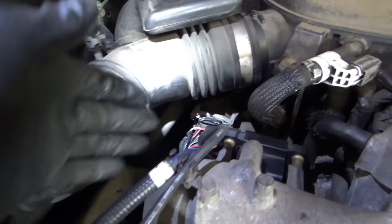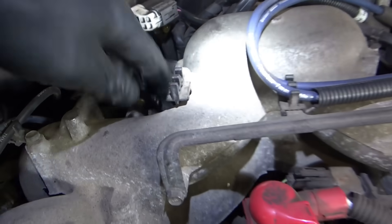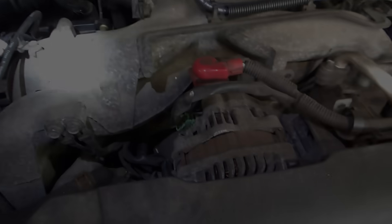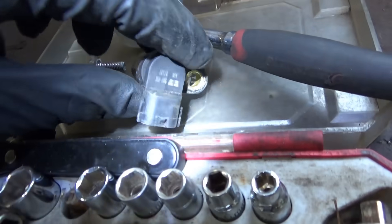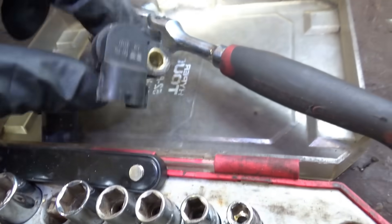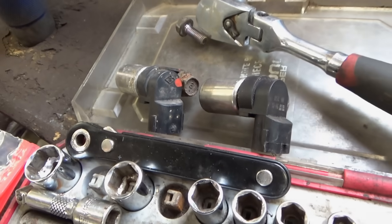Put the plug wires in the right place — top coil is cylinders 1 and 2, bottom coil is 3 and 4. We'll scope everything: cam, crank, and the two trigger wires. Here's the flying-wings aftermarket unit, and here's the OEM — it's even a little heavier. OEM crank sensor is installed. I'm feeling lucky — let's crank this thing over and see what happens.